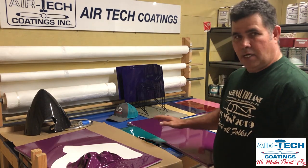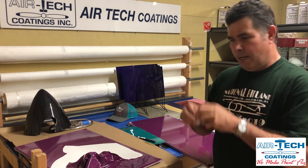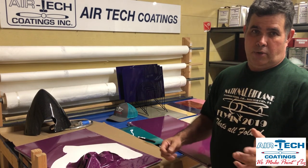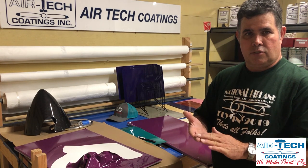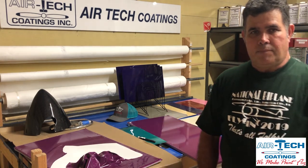I hope this little tip helps. When people say to sand the primer to get a mechanical bond, that's what we're talking about — getting it to where the paint has something to grab onto. Some primers I've tested, including my own, will hold pretty well. But this was not Air Tech primer on here. I'm always cautious because the instructions say to rough it up if you're going to paint after a certain length of time. Thank you.